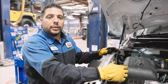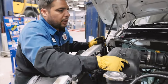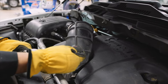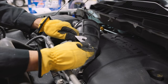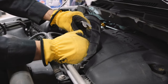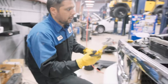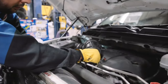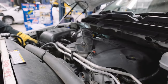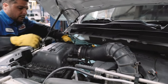The next step is to remove the air box. We're going to take off the evap hose. We're going to disconnect the intake temperature sensor — the way you do it is you move this little red safety latch back, which will allow you to compress the little tab and then pull back while you're compressing it. It just disconnects that easily. The standard size for a lot of these hose clamps is 5/16ths. If you can't reach it that way, you can use a socket or a flathead screwdriver. Unlatch the cover holders — this one has four of them.